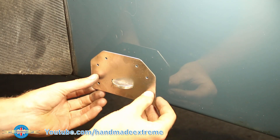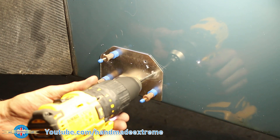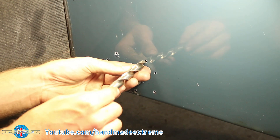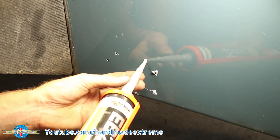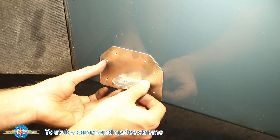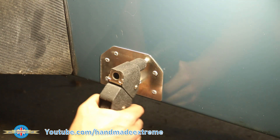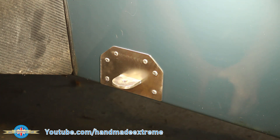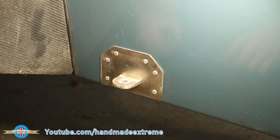I made a little fascia plate, again from 304 stainless, just to cover the old rivet holes and tidy up around the hole for the new bracket. The skin pins did a lovely job of holding everything in place while I drilled for the new rivet holes. All of the holes were thoroughly deburred, then got a light coating of EB25 sealant — a friend introduced me to this stuff on a job a few weeks ago and I'm really impressed with it; I'll drop a link in the description. With the fascia in place, I put the rivets in and popped them down. I think that looks a lot nicer than the old one and should be a fair bit stronger too. I just used a rag with a bit of solvent to get rid of any leftover sealant squeezed out while doing the rivets up.